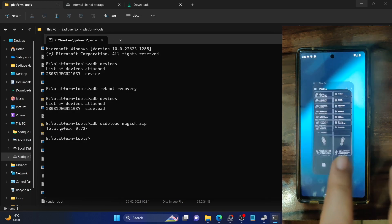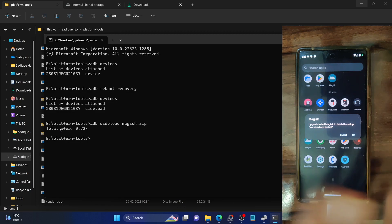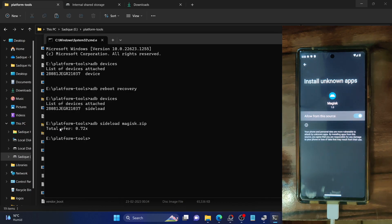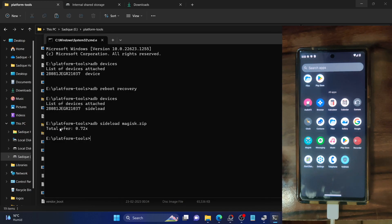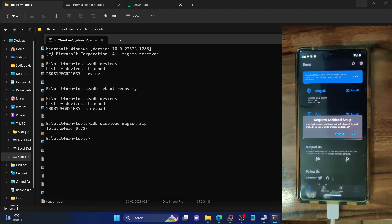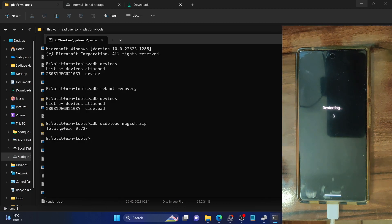The app is now launching. As you can see, it's asking for an upgrade. From the app, launch Magisk and once you get this prompt, tap OK. It will download additional files. Go to settings and enable the toggle next to Magisk. Once done, tap on update and Magisk will update in the backend. Now, once you launch the Magisk app, you'll get a prompt that you require additional setup. Simply tap OK and your phone will undergo a reboot, taking around 5 to 10 seconds.